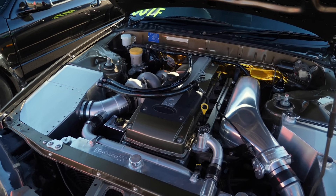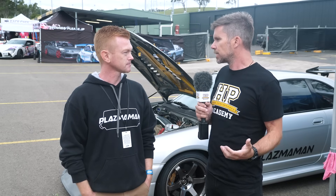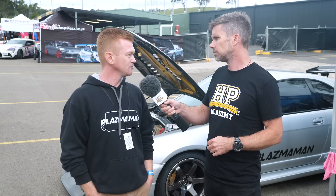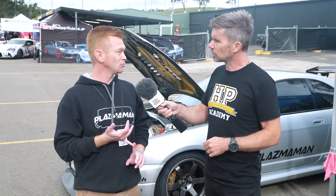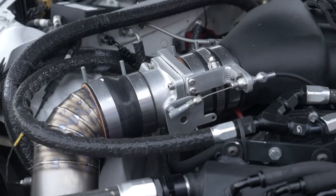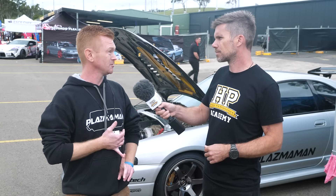To give some actionable numbers: for a two litre four cylinder engine at 400 to 600 horsepower, somewhere between 60 and 70 millimetres would be fine. A good example is the Barra engine — it has a 70mm butterfly, 80mm outside — and that'll support 1,000 horsepower. As a general rule: around 60mm will support around 800 horsepower; 72 to 74mm drive-by-wire is good for about 1,000; 85mm is usually good for about 1,500 horsepower.